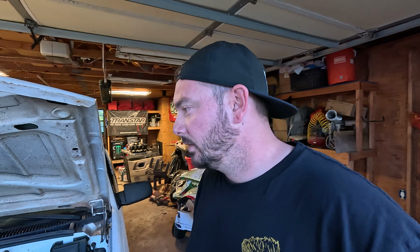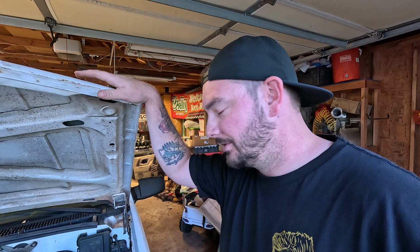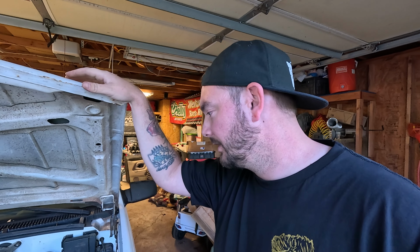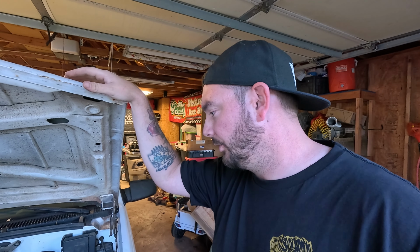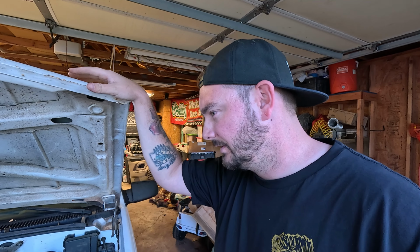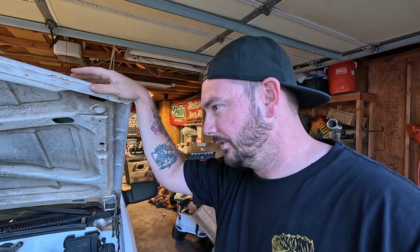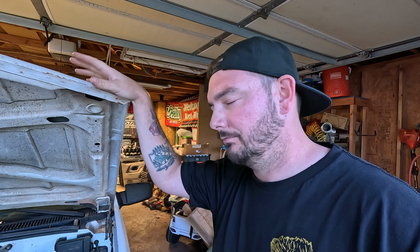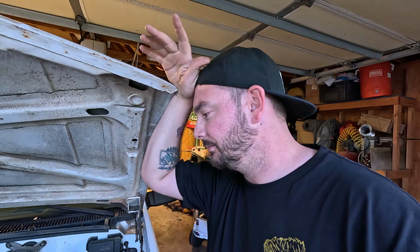Okay, so we were trying to figure some stuff out, so I wasn't recording for a minute, but I gave them the wrong gears. So we had to figure that out because the speed wasn't right, and then we fixed that. So this actually has 373s in it, not 342s like I thought. So we got that fixed, and then we went driving a little bit more, and it was kind of acting like it was loaded up, and then it was also acting weird, like it wouldn't shift unless I let off the gas. And air to fuel looked good, everything looked good on the laptop.